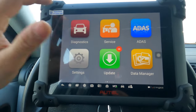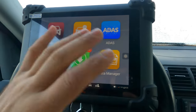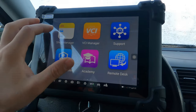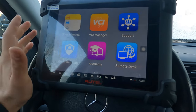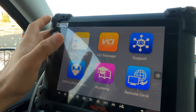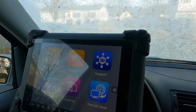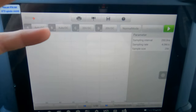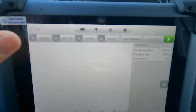This is the screen you get once you open it up. You can buy the ADAS equipment — I don't have any of that at the moment, those can be pretty expensive, around eighteen thousand dollars. There's a shop manager, VCI manager — you can update your VCI through here. For OEM authorization, Chrysler vehicles 2018 and up require that to perform any programming. It also has a MaxiScope — I bought the Autel MP408, which hooks directly to the scan tool without needing a laptop.